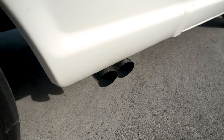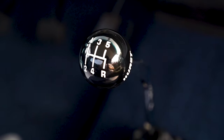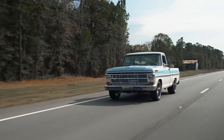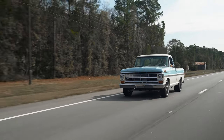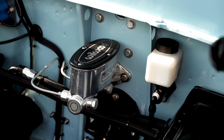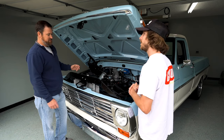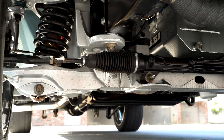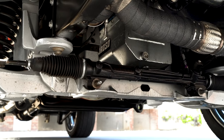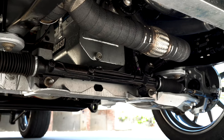This is an old five-speed — it's a Tremec 3550, been around a while. The clutch is a McLeod hydraulic throwout bearing with a Spec clutch in there now. I see you have the Wilwood brake master cylinder — is it Wilwood's all around? No, that's just the master cylinder. I left it manual — it's just manual brakes. We upgraded to power steering with the Crown Vic front end. We cut the old cross member out and put the Crown Vic front end in — it's really made for this truck, as most people know.